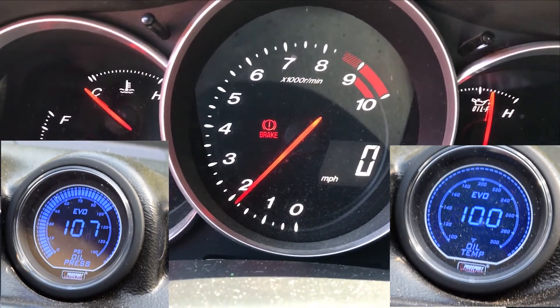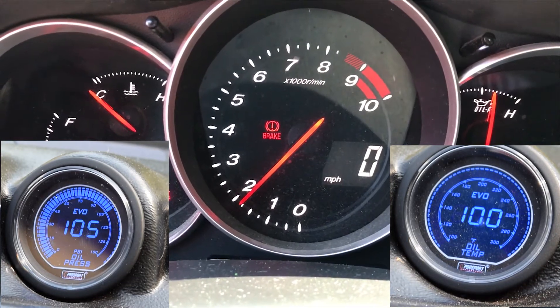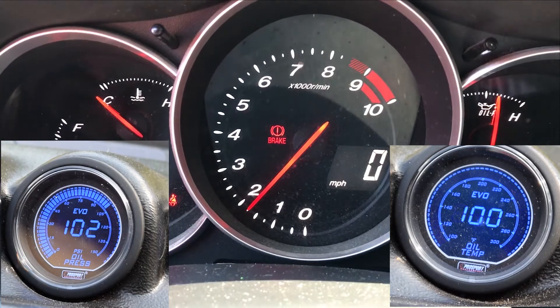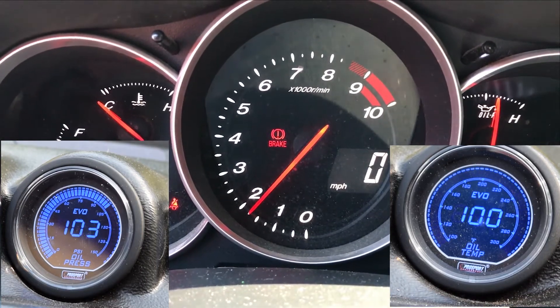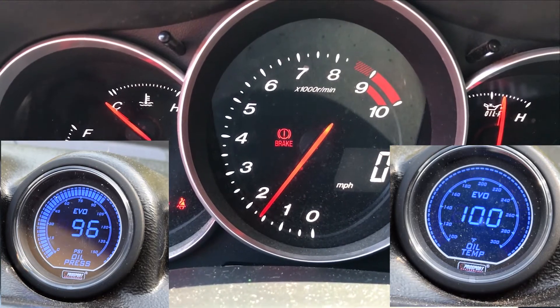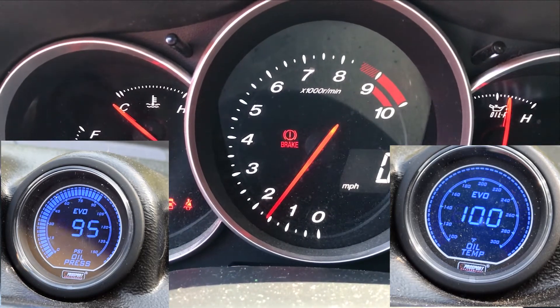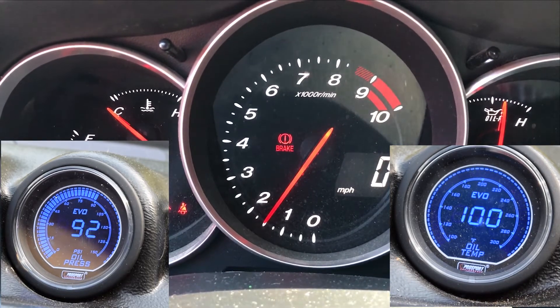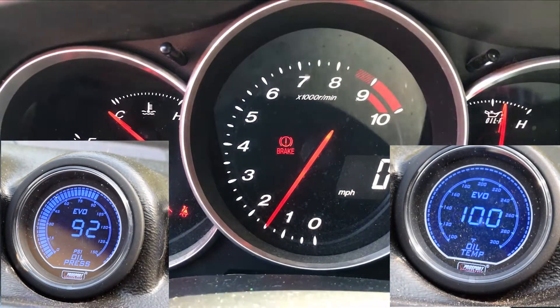So there were about just about 1800 RPM cold oil, over 100 PSI. She's warming up just a touch and kind of bouncing between 1500 and 1750 — still pushing almost 100. You can see at about 1500 RPM there, still pushing in the 90s.